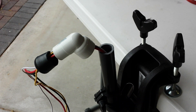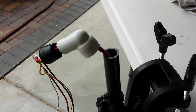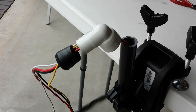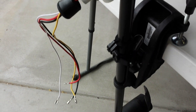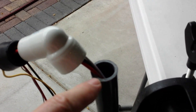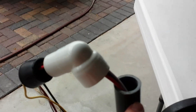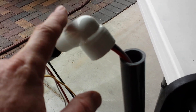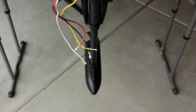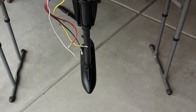Here's an exploded view of the end of the shaft with the 90 degree turn that's been heat formed, along with the little chair stop and the wires threaded through. I'm going to put a thin coat of marine goop around the edge here just to hold this piece in place. When you do that you want to make sure it's aligned straight with the shaft and the nose of the trolling motor.